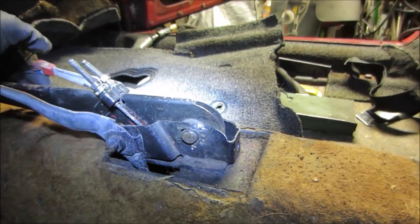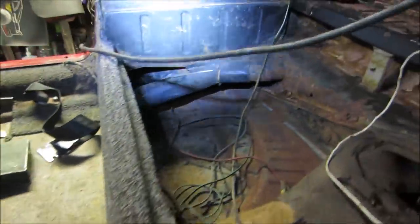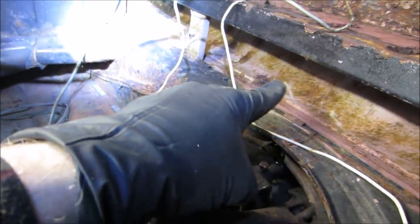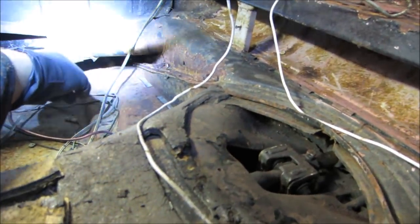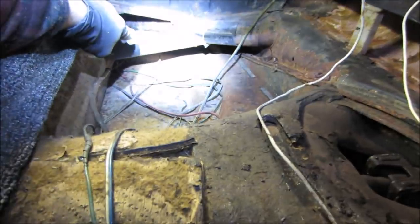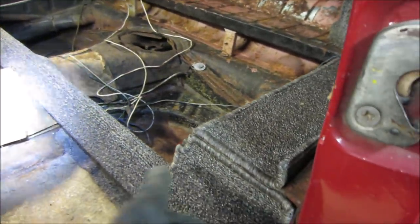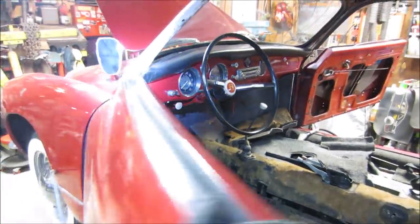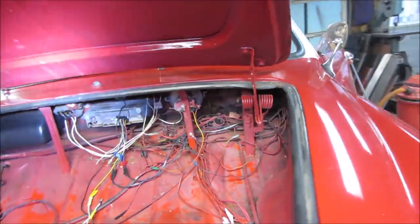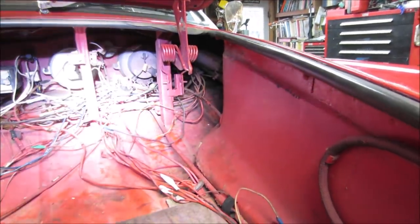These are your heat controls. This one goes to your heater boxes — opens and closes them — and this one dedicates where the heat comes from. From the engine, back behind there the heater boxes come through and exit through there, dumping down into what's called the heater channels, which run down each side of the car to the front. They also have heat that gets redirected right out of these tubes right there. They have doors on them that open and close — that's what the other lever does. If they're closed, the heat runs through the heater channel, up through the dash, and out. The hoses are up in there with more linkage, so it can dump out there and also by your feet down on the heater channels.